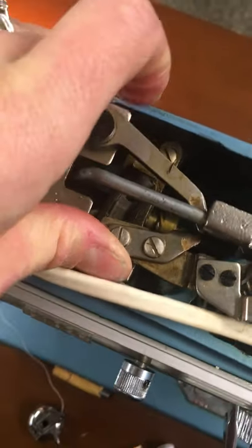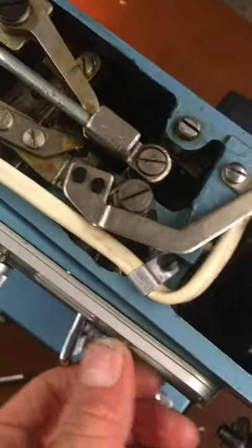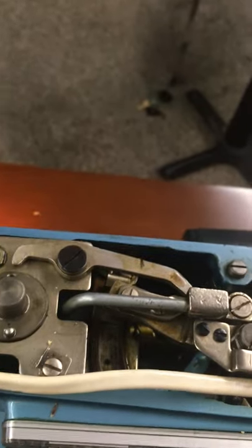There is a lever right here — this is where the zigzag basically activates. Machines like this, if they have a cam also, the lever that switches often gets gunky, depending on the kind of sewing machine oil they use. These would not turn, so I literally had to spray them down from the inside — they were completely stuck. So basically, this little lever — if you have a stuck machine and it's only in straight stitch, don't go pulling this like crazy; you're going to break this little lever. It had been soaking for about six hours with WD-40 and still wouldn't budge, so I very gently pry a little bit to get some movement in there.